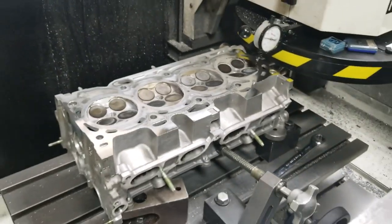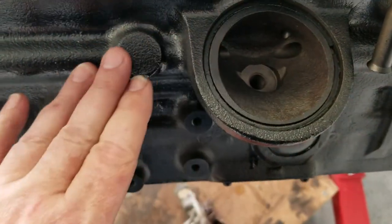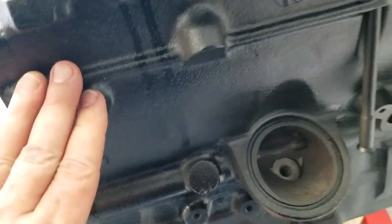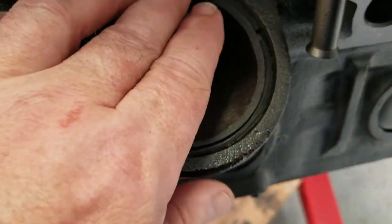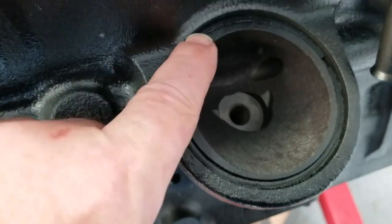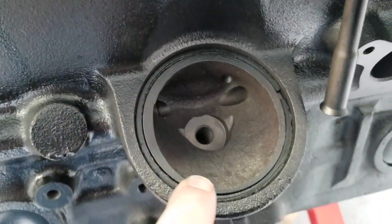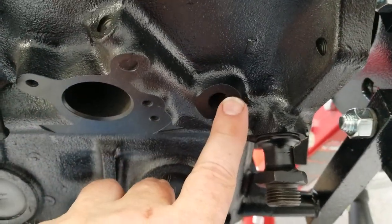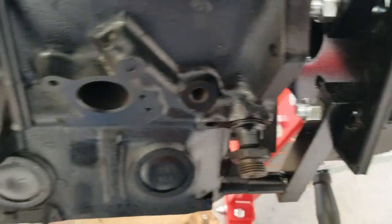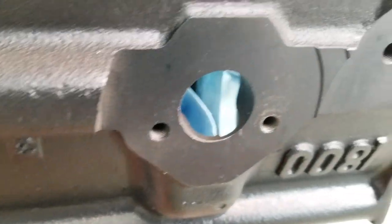On this side of the engine it needs to be cleaned up a little bit. In the machine shop they sprayed the outside of the block down to keep it from rusting during storage, but there's paint on the gasket surfaces. These need to be brought back to bare metal. Any place where the gaskets go, I'm gonna bring it back to bare metal, get these threads all clean so we get a good seal. I think there's just that one surface right here.